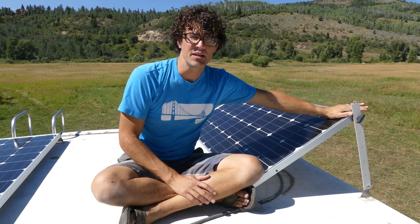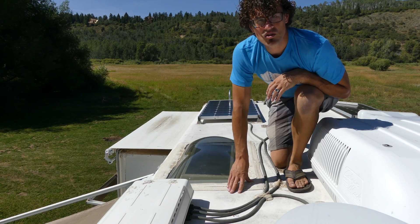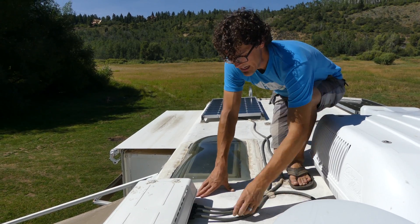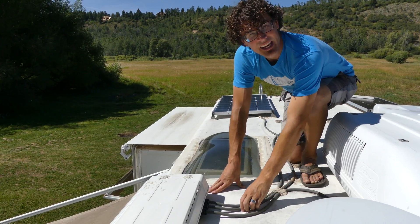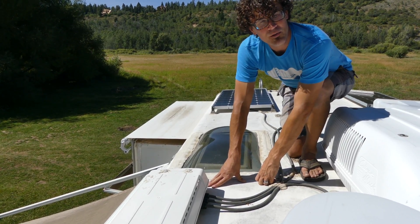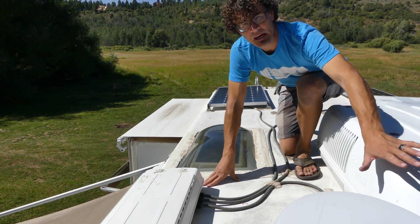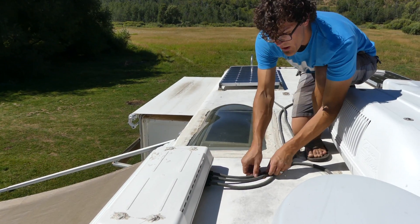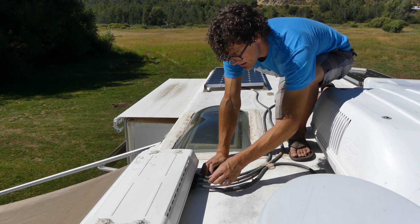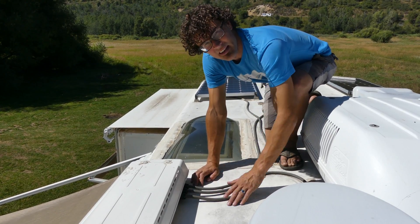In the winter when the sun is very low in the sky, it's helpful to tilt the solar panels up so that the sun hits it more directly. We created a very simple method to tilt the panels up — it's a thin piece of aluminum metal, about an eighth of an inch thick and a couple inches wide, and we drilled various holes in it so that we could tilt at various angles. I just put one bar up for demonstration purposes but normally I would put up a second bar on the other side. Despite being very stable, I would never drive like this — we always put it down for driving and in high wind conditions. The wiring for the solar panels and this combiner box I got from a place called AM Solar in Eugene, Oregon. Our solar panels are wired in parallel and they all connect in this combiner box.